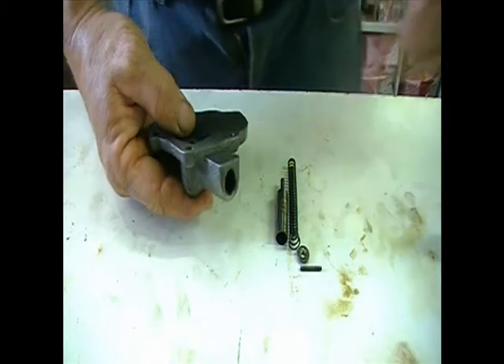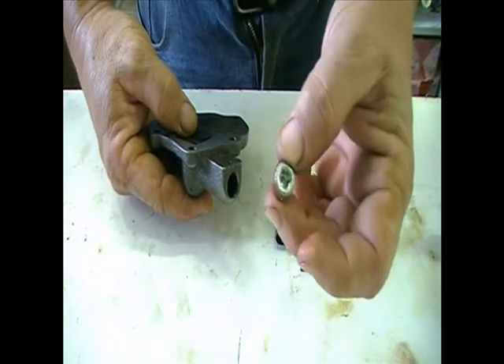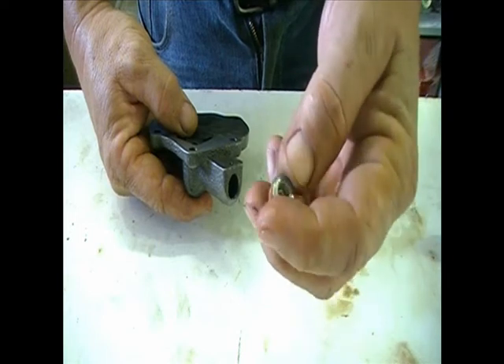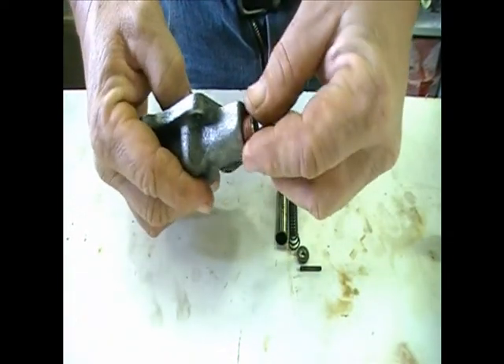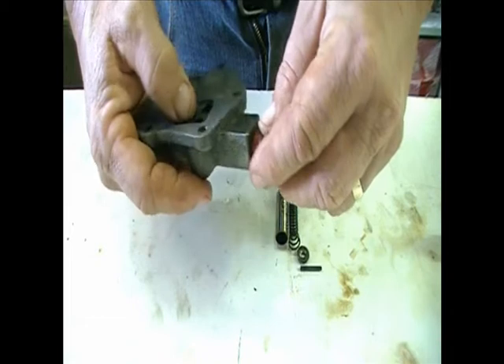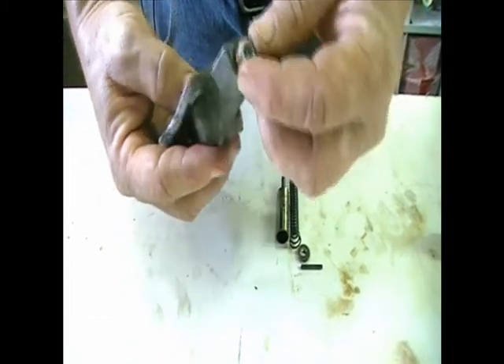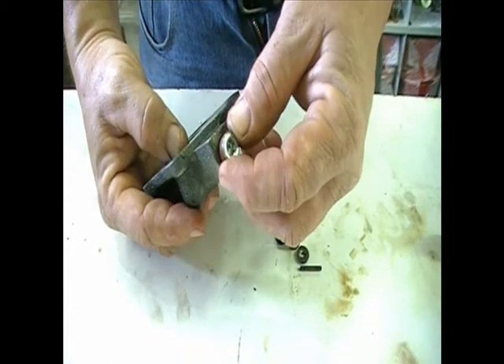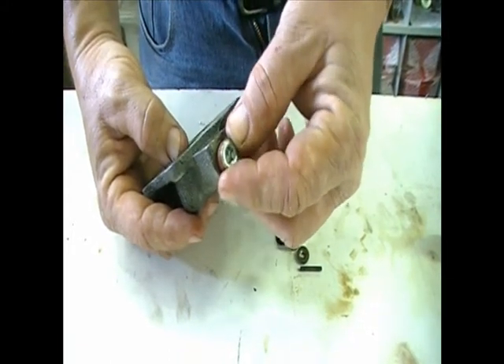So I thought I might consider an alternative idea. My first thought was to take a quarter-inch pipe plug, thread the end to NPT, and put it in and tighten it down — obviously having to drill a hole in there so it relieves the pressure.